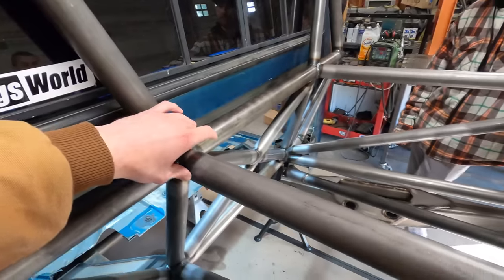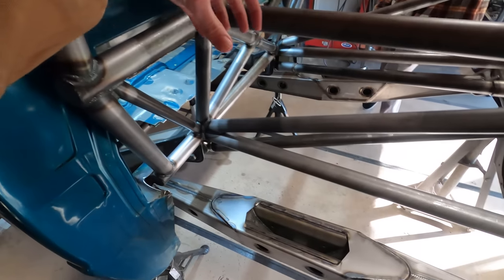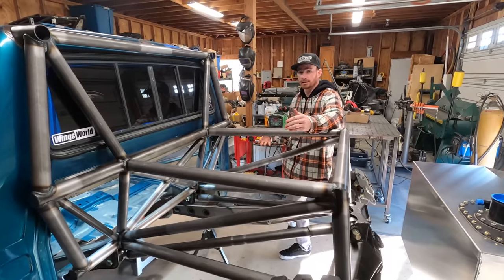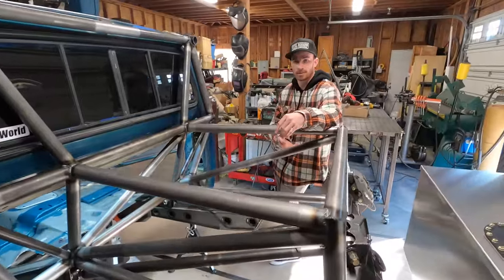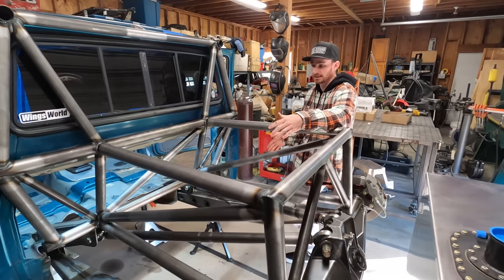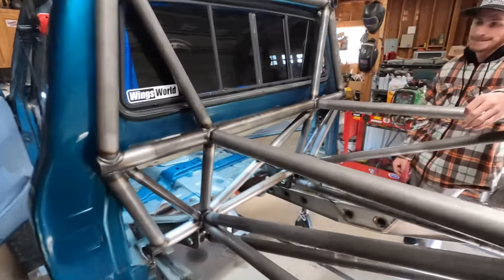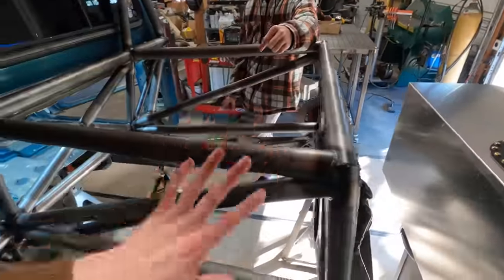This is your main node to head tubes backwards, and eventually you'll have one coming off here with your shock mounts right in here. Just because I've never done a back half on a truck like this before without a frame rail, this setup took a lot of forethought — thinking about layout, shock clearance, width of the cage, height of everything, where I want the truck to bump out at. All those things you don't really have to think about when you have a frame rail because you have set parameters already. You can screw yourself very quickly on layout and packaging if you don't think 13 steps ahead.